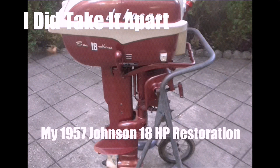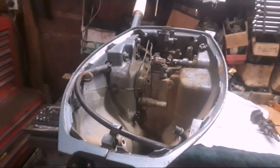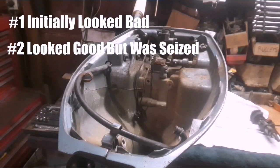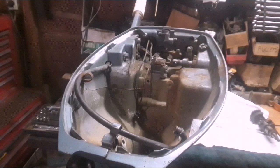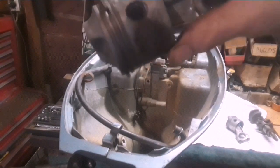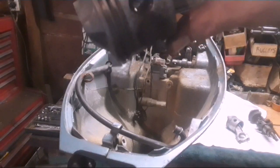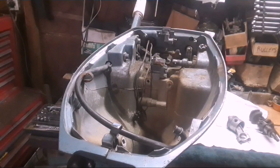Here's what we have up to this point. Took it apart last night. Tried to free it up with the breaker bar on the flywheel nut and tapping the pistons gingerly — couldn't free it up. Turned out number one piston wasn't hung up at all — the one with all the dirt in it in the previous video — relatively clean, rings aren't stuck. But number two, water came in, leaked in through the ports, and it locked up. You can see. I'm going to clean all that up. If it's not pitted I'll use the piston over again; if it's pitted really bad I'll use another piston. The rings are 90% free — stuck in a couple spots, but I think I can free them up and save the rings. Number two was hanging up — that's why I couldn't free it up.